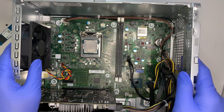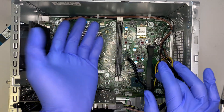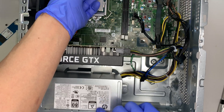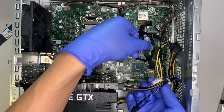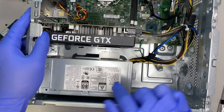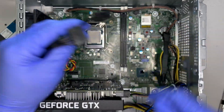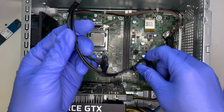This is a four-pin connector — the brown and black cable here goes all the way to the power supply at the bottom. This motherboard does not have a 24-pin connector; it is proprietary and only runs on a four-pin as well. The motherboard consumes very low power, which is why this power supply is proprietary. The motherboard also supplies power to the hard drive — it's not coming from the power supply directly. The power supply feeds the motherboard, and the motherboard feeds any additional hard drive.